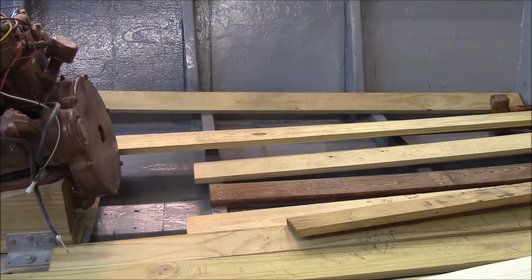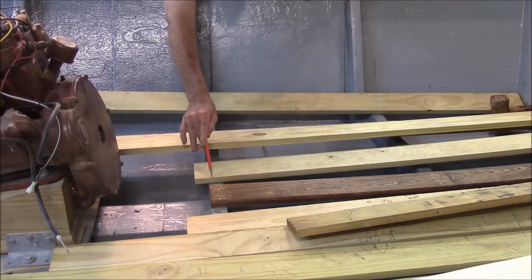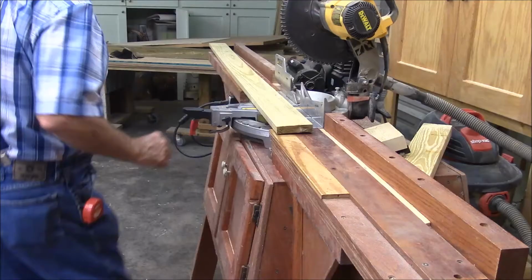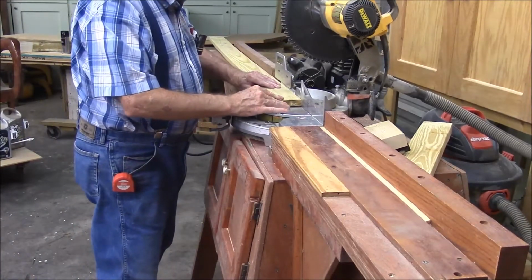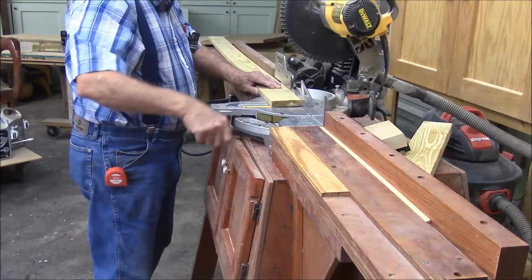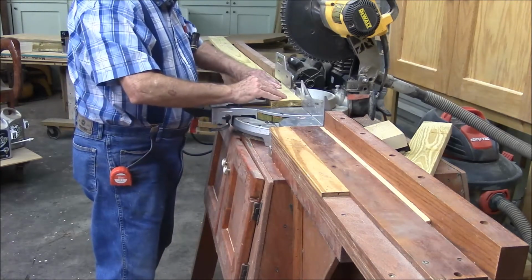Now I'm putting the floor of the boat in. I'm making my deck planks out of 3/4 inch thick treated deck wood. The reason in the last episode I had it out drying, it doesn't have to be perfectly dry because it's not going to be glued, but I am going to stain it, so it has to be somewhat dry. Of course, I know how long this board needs to be because I measured it, but you saw me mark it in the boat, and that is the process of double checking my measurements.